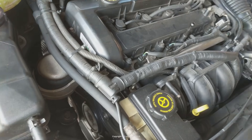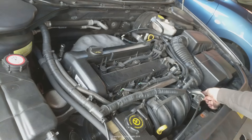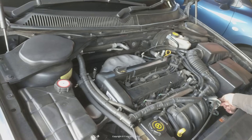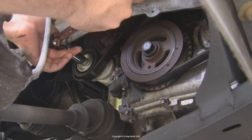But I also knew it had started after I replaced the accessory belt, so that's suspicious. You know, new tensioner, new belt — which is not as stretched as the old one — and so maybe that means more force on the pulleys.